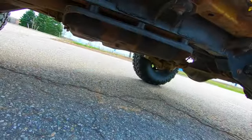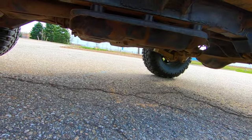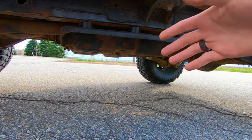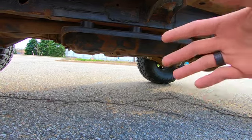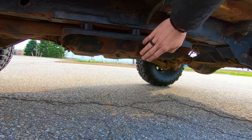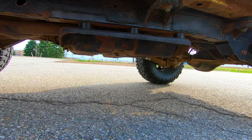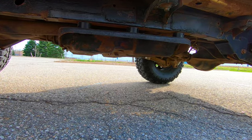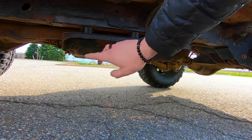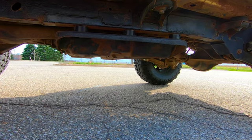And then you'll notice the skid plate. The skid plate is usually very rusty because, as the name suggests, it skids along things when you go off-roading. And if you're not buying one that's been off-roaded, then check the skid plate for scratches and for marks, because if the guy's telling you it hasn't been off-road, that's a very good indicator if it has or if it hasn't, because with the amount of ground clearance you have here, snowbanks and stuff is not gonna cause damage to that. So definitely make sure you know what you're looking at.